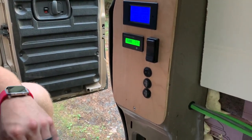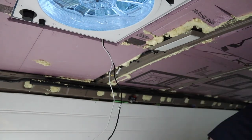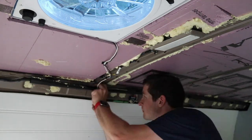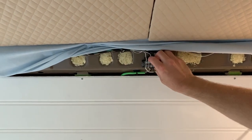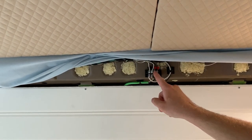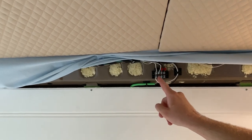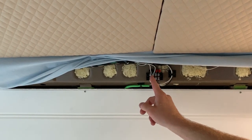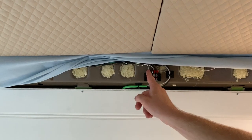This last one here is just a spare. The fan and these two lights run off the 10 amp circuit from the fuse block. The wire from the fuse block comes into this terminal block. There's a jumper connecting groups of terminals, so all four on one side are connected electrically and all four on the other side are connected electrically. The ground from the lights and fan comes in on one side, and the positive connections for the fan and the two lights come in on the other side.